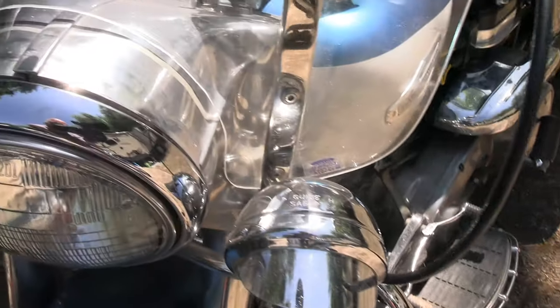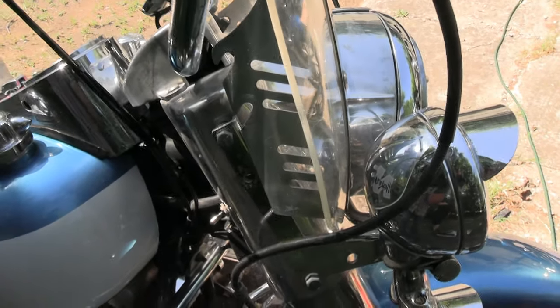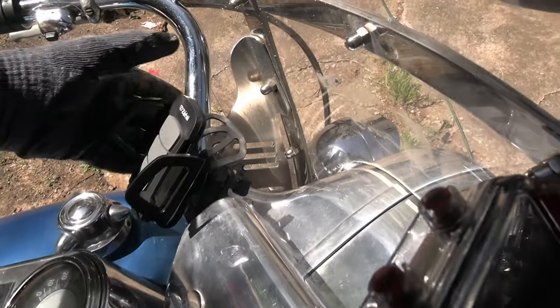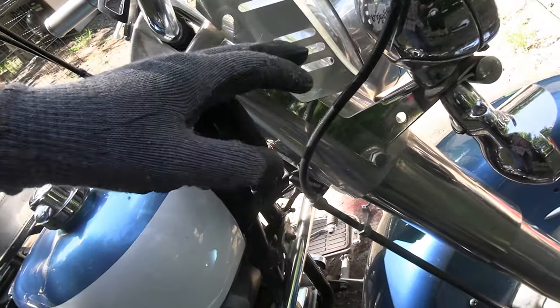All right, guys, so it fits around my headlight now. I was looking last night at my brackets. They looked like they would fit, but looks like they're just not long enough. So what I think I'm going to do is put either some spacers back behind here or build a bracket that'll go from here out with bolt holes, and then I think that'll hold me out enough.